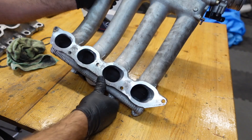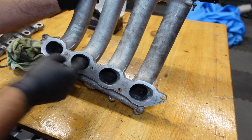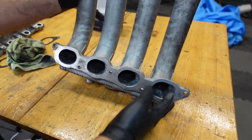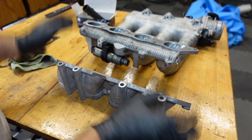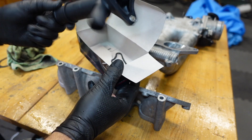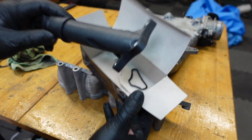All blended in. Obviously you're going to be limited on how far you can go - I've done maybe about 25 mil, an inch in, really blended it all in so it's all smooth. And there you go - nice port matched bottom half and top half, all done, that's clean. Now the main event, why we're actually doing this, is to replace this coolant flange. Let me show you how I'm going to go about replacing it and removing what's left of the lower half of the manifold.